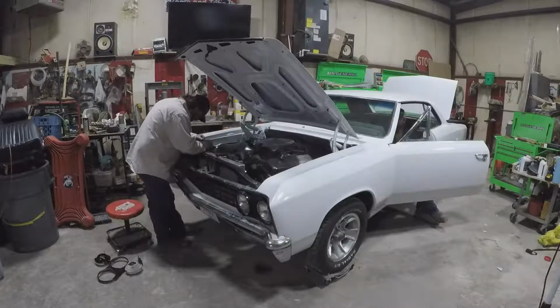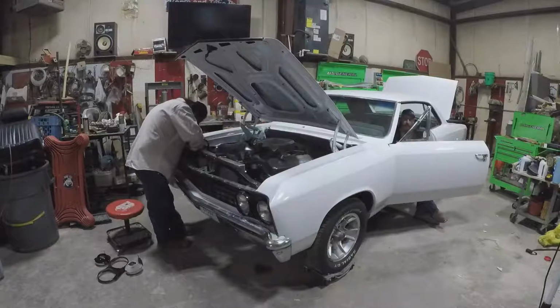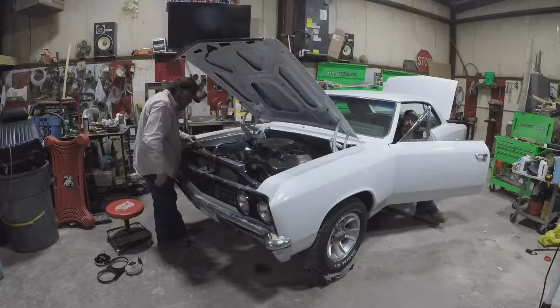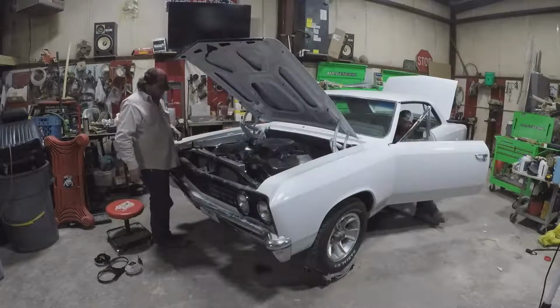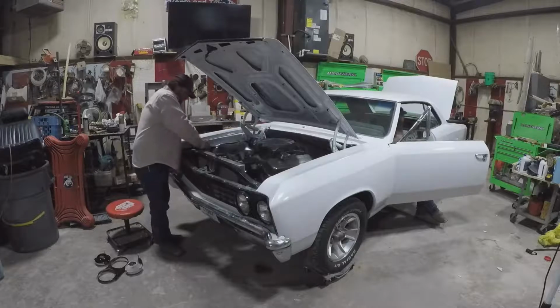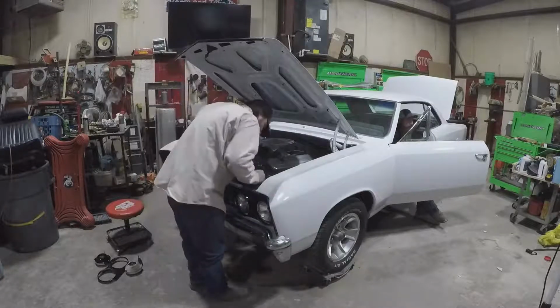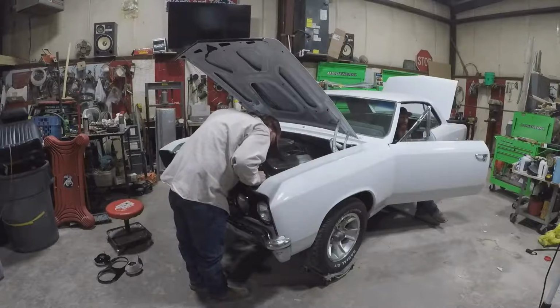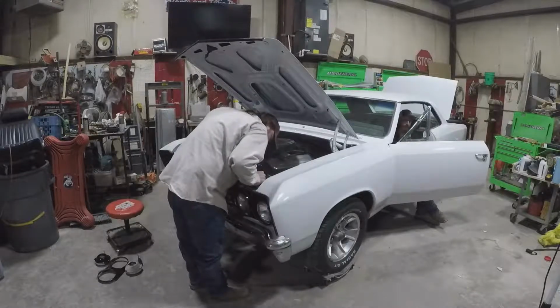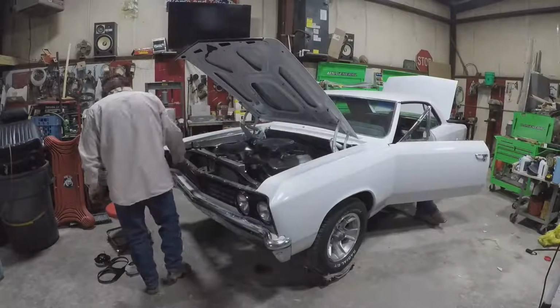So what I'm trying to do here is start at a clip and just see if we got power to the tail lights and the rear harness area. If we got power back there, we know there's a ground issue or something else. So just touching this thing to stuff. Cool. Test light. That's the word. Not a Tesla. Test light.